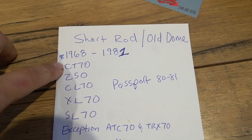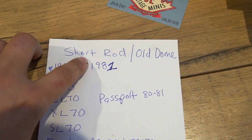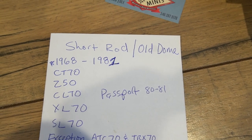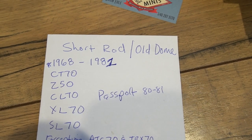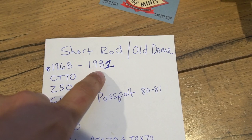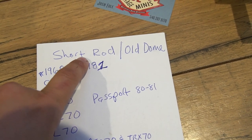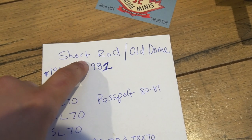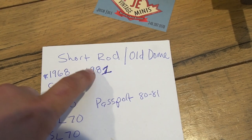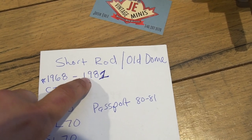If you're dealing with a vintage bike from 1968 through 1981, you're going to have a short rod. The eBay or Amazon kits that say they refurbish your top end with a new cylinder head, a new piston, and a new jug kit are not going to be compatible with the short rod years. They will assemble, but your rod is not designed for the wrist pin location and piston dome of those kits. It will run, but with really low compression and really low power. There's not really a cheap solution for these year bikes.